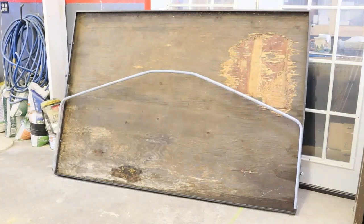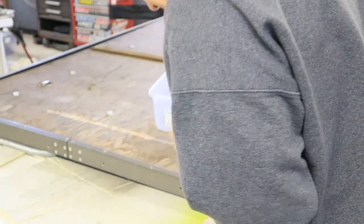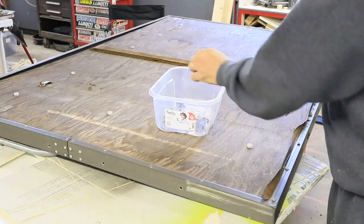Today we're going to rebuild these slide-out beds and reinstall them on the Jayco pop-up. My thoughts were that since this plywood is rotted, I was just going to slide the plywood out and replace it. But no! The frame around these slide-in beds are built around that plywood, so these frames have to be disassembled in order to get the plywood out.